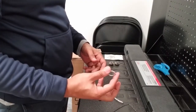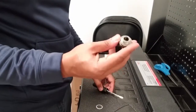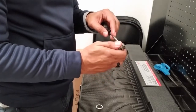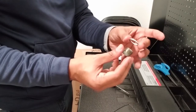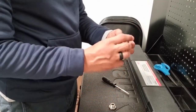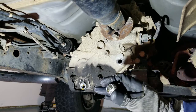I'm also going to replace the washers before I reinstall the drain and fill plugs. These washers are sometimes on there a little tight, so I take a flathead screwdriver and gently maneuver the old washer off. New washer applied to the plug. I'll do the same for the fill plug. The transfer case is finished draining, so I'll go ahead and replace the drain plug with the new washer on there.